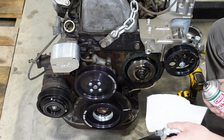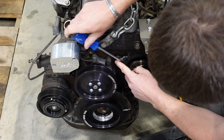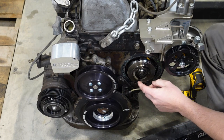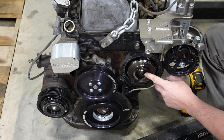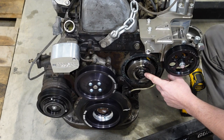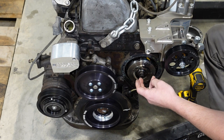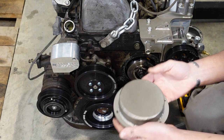With the pump removed, clean up your mating surface on the block really well with brake parts cleaner. Supposedly, this bolt that protrudes out has a thick washer underneath it — you can take that out and put a normal thickness washer underneath instead. Just make sure that bolt's not going to bottom out, then tighten it back down. I believe that's only on the '79 and '80 models without EGR; everything else should be pretty standard and not require any modification.